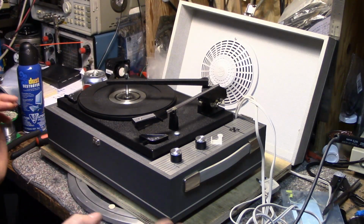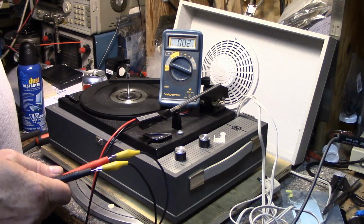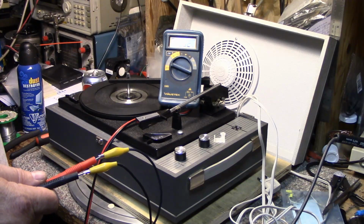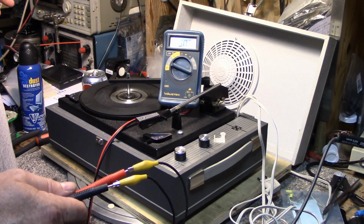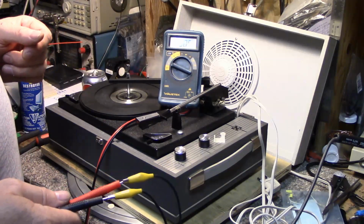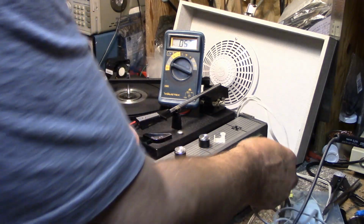Let's try and rig up some kind of power to put some life to this thing. See what I can do. So I got my Widowmaker plugged into my auto Variac, which is an auto transformer, which can do a little bit of stepping up, not much. And then I got it through my isolation transformer, which also has taps for different line voltages. So I'm able to jack up the line voltage here to, let's see, I got it connected. And I'll show you what it comes out at, 160 volts. That's probably about the best I can do without making a dedicated step-up transformer.